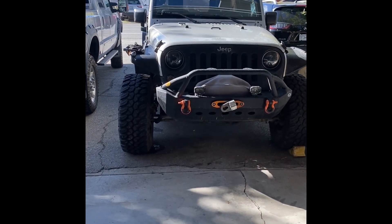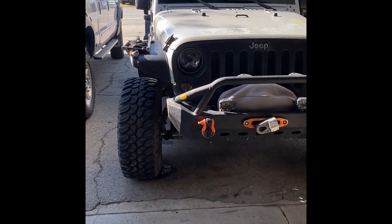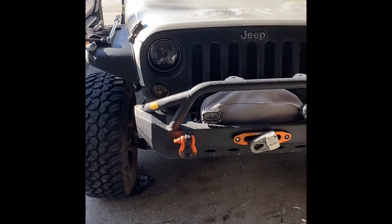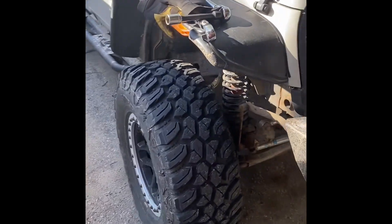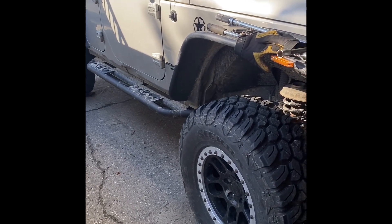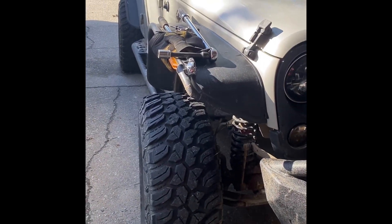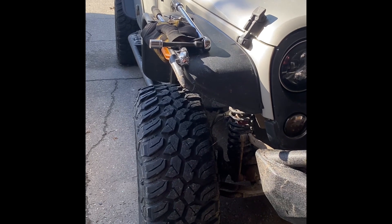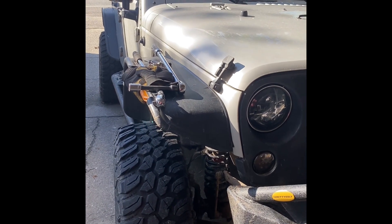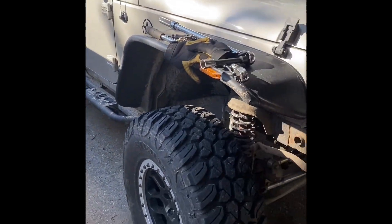What's going on YouTube? I'm just in my driveway swapping over all my vehicles to winter tires, so I figured now would be a good time to show my onboard AC system - an air compressor system I built from an AC unit out of a 2011 Jeep Liberty. I looked up on the Sanden website which one had the highest CFM output and it was the one in the Jeep Liberty. The 709 is one of the most popular ones for onboard air systems, but I wanted something with a little bit more CFM.